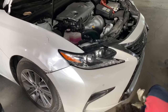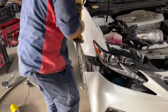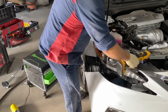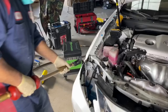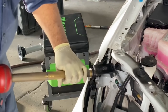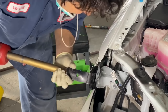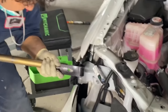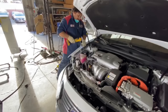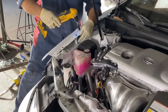Next step, I'm going to do some R&I — remove screws and clips so I can pull the bumper and the headlight. This time I'm going to fine tune the bracket and the outer frame. Next set of pulls is critical. Using the slide hammer to hammer forward the fender bracket — this will help get the fender off the door. Second, pulling the fender nose out to line up with the bumper. Next, using a 10 millimeter socket to loosen the entire upper section of the fender for realignment.